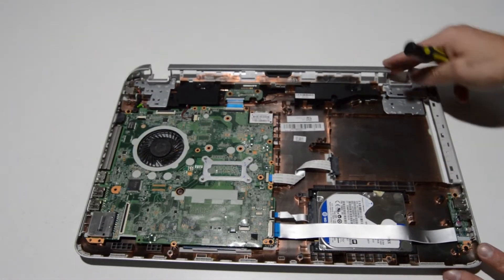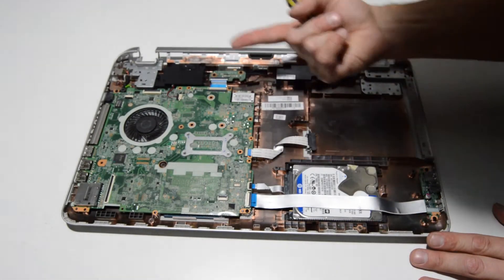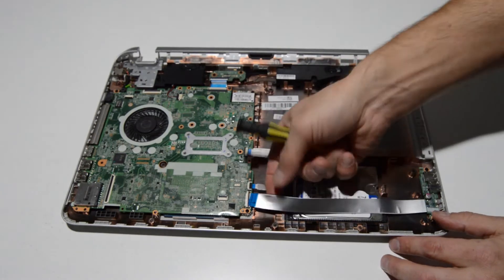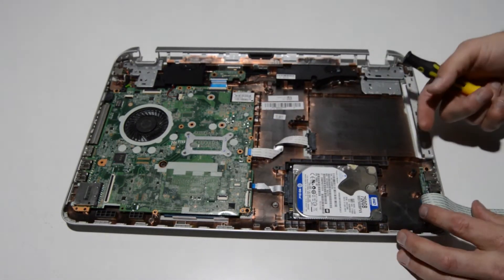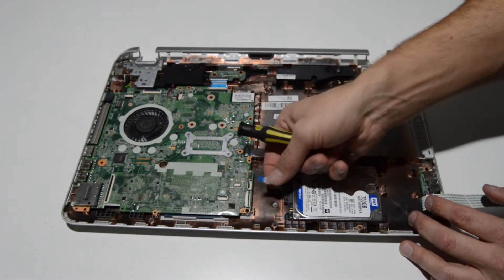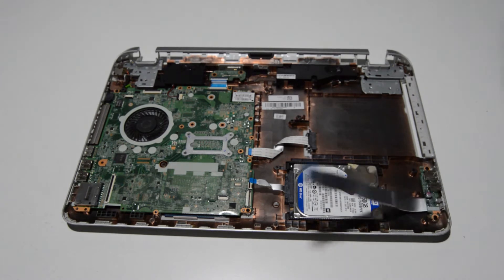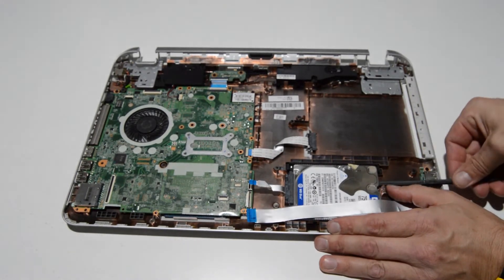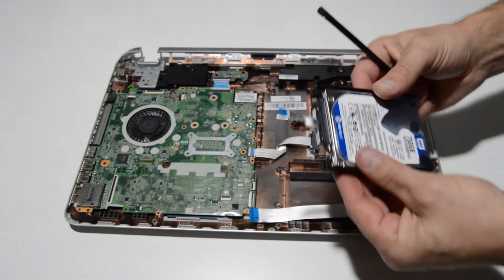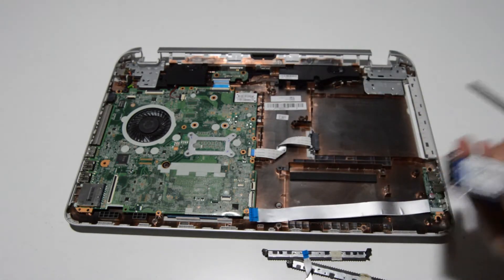We'll set the display aside for now. If you're upgrading your hard drive, it looks like it's just disconnecting one ribbon, and this hard drive caddy doesn't have any screws. You'll have to remove the ribbon for the USB port to get that out of the way, and then another flip-up type connector and another ribbon that you have to lift up before you can pull out. We're going to just need to pry up a little bit on that hard drive — it's in there by a compression fit — and then pull out the sides of the caddy and pull off the SATA connector.